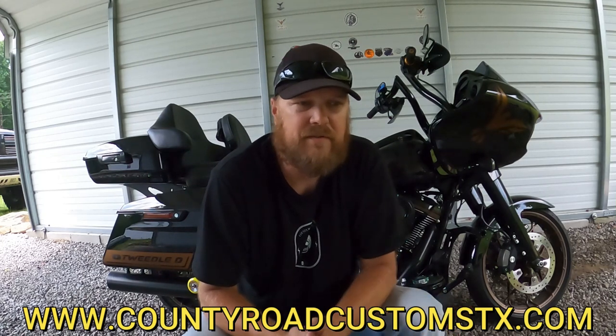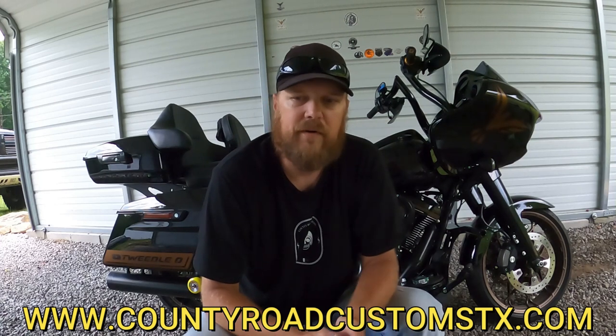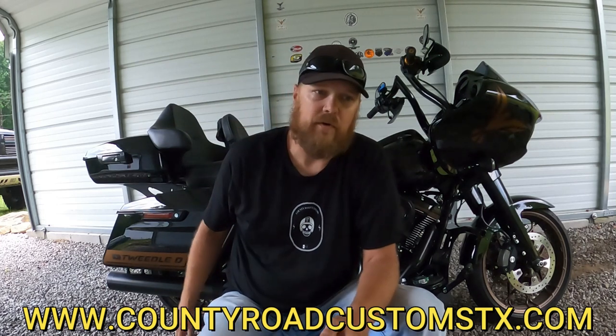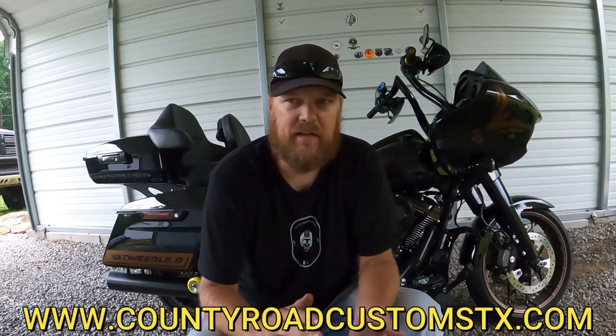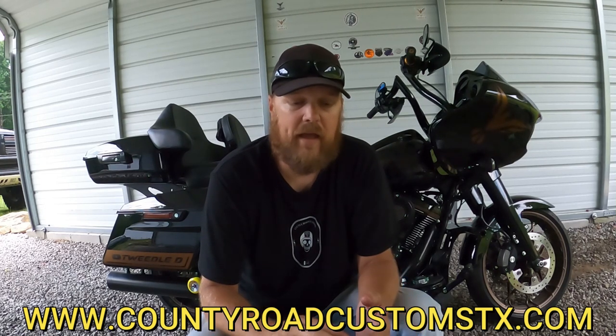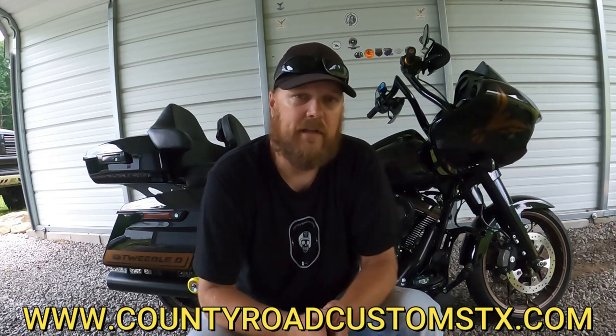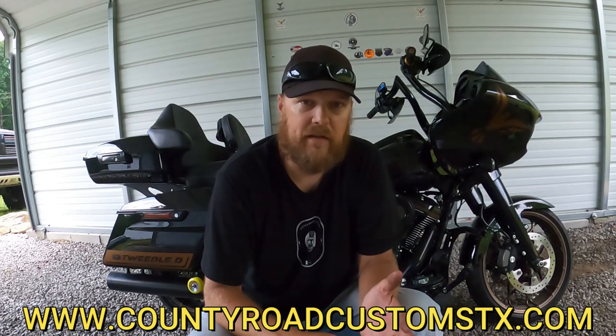I'll probably have voiceover on the rest of this since my mic wasn't working. I know somebody's going to say why did you use a pipe cutter — why not a die grinder or a grinder with a cutoff wheel? Yes, those would have been faster, but I didn't want to nick my exhaust. I wanted a clean cut with nothing to clean up afterwards. A pipe cutter also shows that if you don't have a full set of tools, you can buy one — it's way cheaper than a grinder. For this job you really just need T-handle Allen keys, a T45 Torx bit socket, long Allen head sockets, a box wrench, and some thread lock. It won't cost you an arm and a leg.